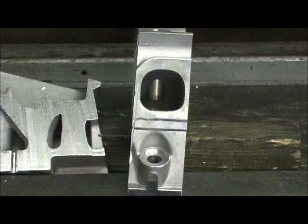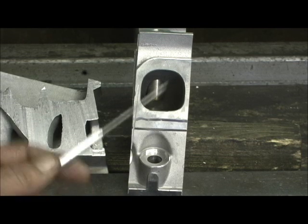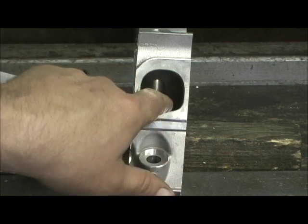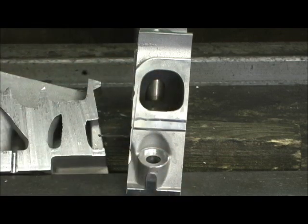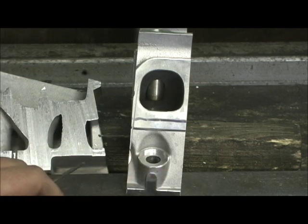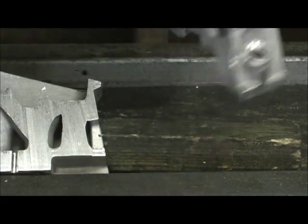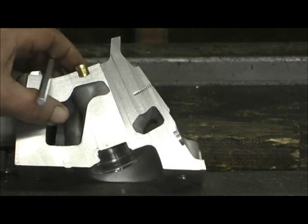Okay. Measuring distance from the deck surface up to this right here, which is our level. I mean, golly, it's just got a beautiful roll right there. So they got us pretty much laid out on the exhaust port. No water jacket worries anywhere where we're going to be cutting the head. I'll turn this around so you can see there.